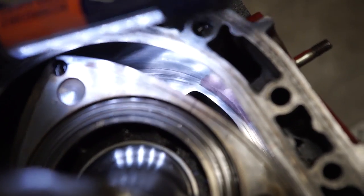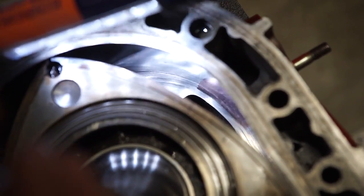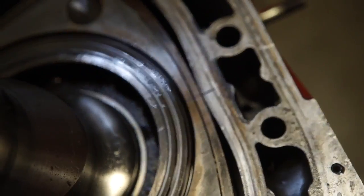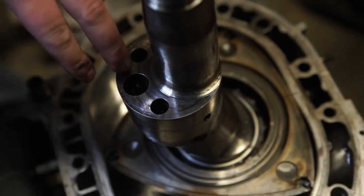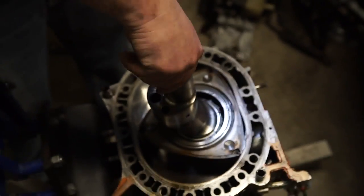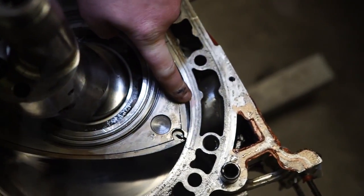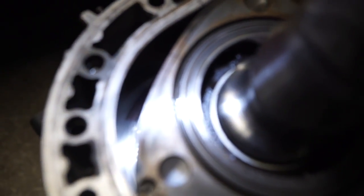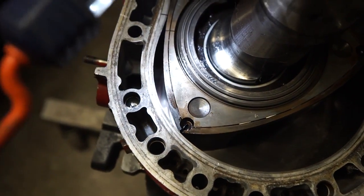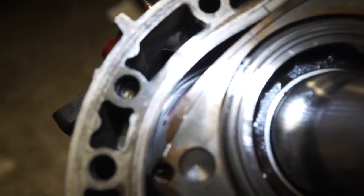As you can see, I marked out the bridge port with a permanent marker. I also added two lines here — one on the housing, one on the rotor. If you look at the eccentric shaft, we've got the top lobe facing off between the two spark plugs. Right here is the top of the exhaust port. Right now the bridge port — as you can see — the factory port is closed, and down in there you can see where we marked where a bridge would be. With the bridge open, the exhaust port is open.